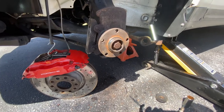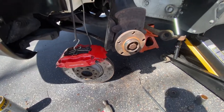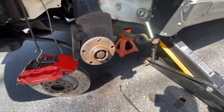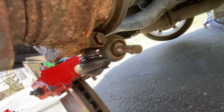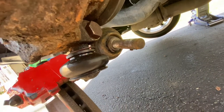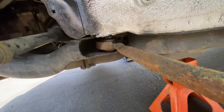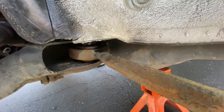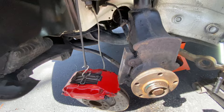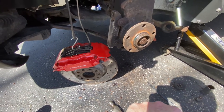We managed to get the outer control arm bushing bolt out of there after a lot of work - it was definitely tough to come off. Now I basically have what's left of the ball joint stuck in here that I need to liberate. I've got the bolt loose, and then this inner control arm with the sleeve - that's gonna be a bit of a fight. Like I said, we're gonna thread in a lug bolt into that and then try to wiggle it out.